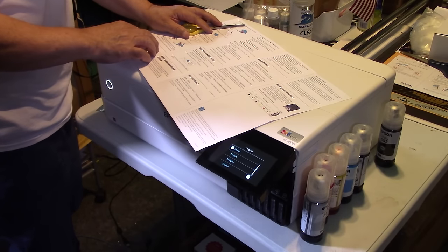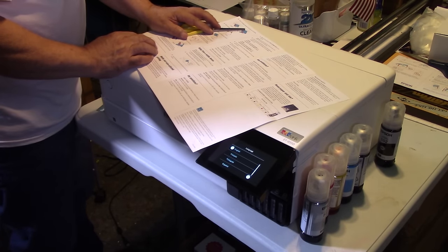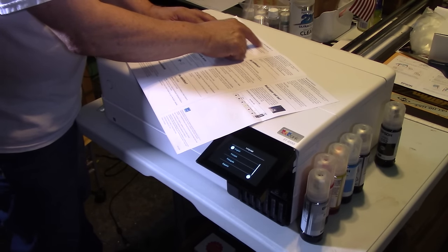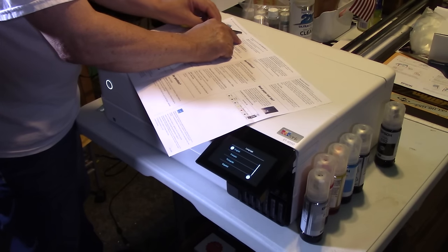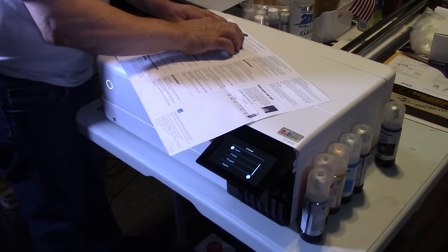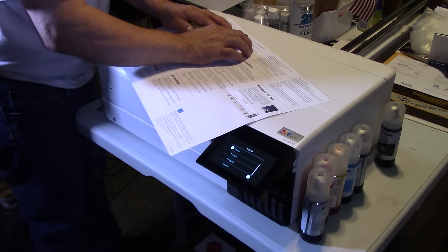But we're going to go ahead and use the installation file that we downloaded directly from the EPSON website. Make sure your product is not connected to your computer. Windows, if you see a found new hardware screen, click cancel and disconnect the USB cable. All right, so insert the product CD, Windows only, or download and run your product software package.